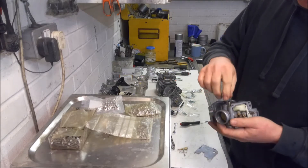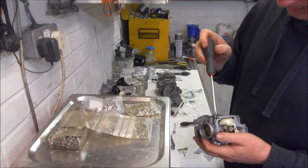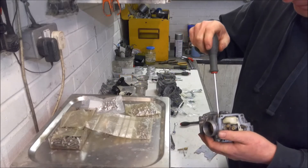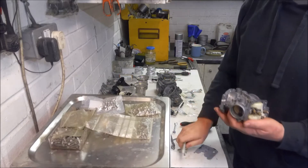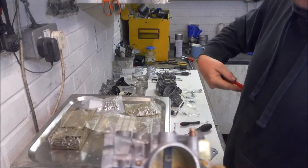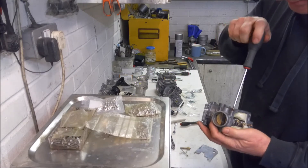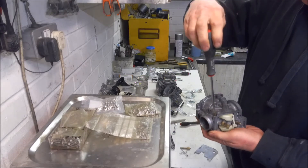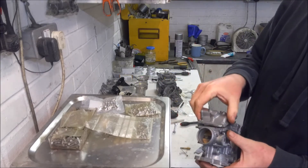This one is actually broken and I haven't got any spares unfortunately - I've got NC23 ones but I'm not entirely sure if they're the same. The trick is to screw it all the way in until you feel some resistance. Then grab a Sharpie, make a mark on the body and on the actual mixture screw itself - it just helps you keep track of the turns. Then go out two and a half turns, and that is your initial setting. You can tweak them, but honestly I've found it very rarely needs it.